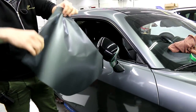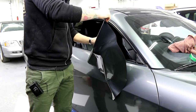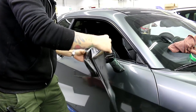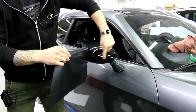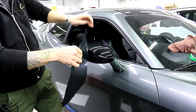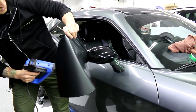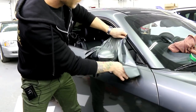Let's do this again. I'm about three to four inches past that tip on this end of the mirror. This is our tension line right here — this is where most of the stretch is going to come across. The vinyl should be stretching so that this can follow in. I'm going to hold it more around the top and I'm going to heat it, and then we're going to go for it. We're going to have to shrink it all back obviously.